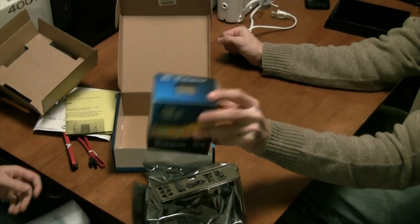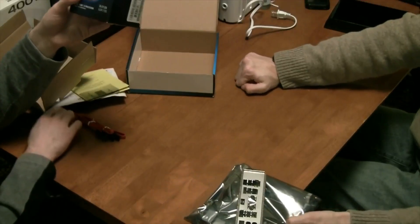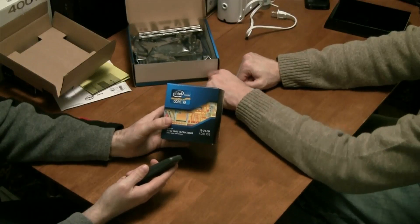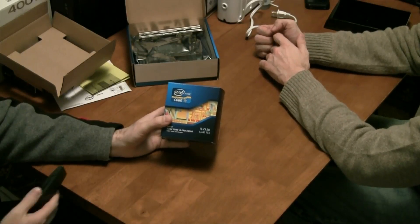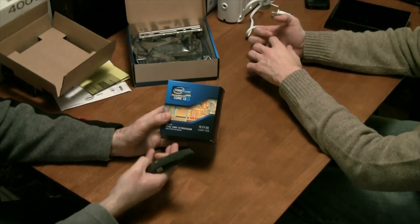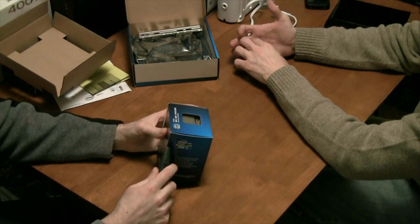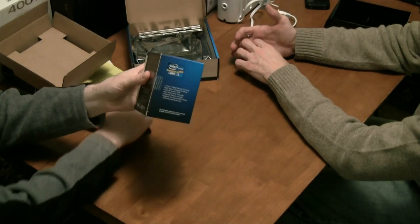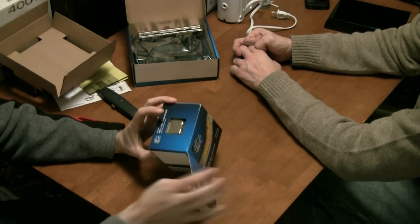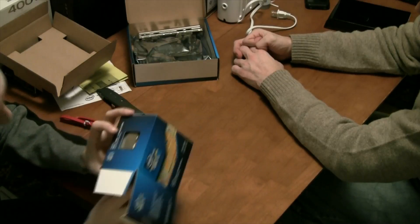That is the processor we're putting in this machine. This is a retail box Core i3 processor, so make sure when you buy your processor that you're buying a retail box. If you don't have a cooling fan or heat sink you're going to put on it, we tend to buy the retail boxes just to get the stock heat sink. We're not going to do overclocking, so there really isn't much need for a custom cooling solution. And you know you're going to be getting warranty coverage with a standard OEM fan. We've got a special Intel seal on this sticker so we know it's genuine Intel — you've got to watch out for counterfeits. We can actually see the processor itself up there, so we can verify it's the correct processor before even opening the package.